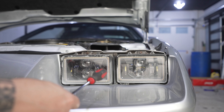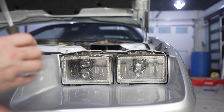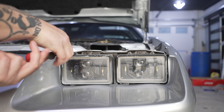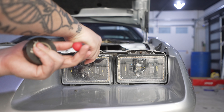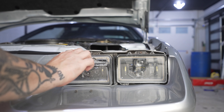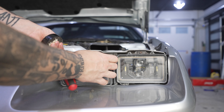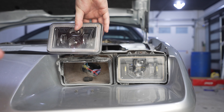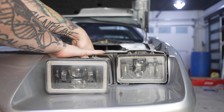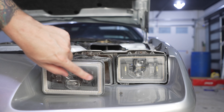So we're looking here at the headlight assembly. Mine's got a little bit of weight — I think a lot of them have little imperfections like this. You probably know about these two screws up here at the top of each of the headlight assemblies, right? You take these out in order to access — this is how you initially would get the light bulb out, just like this and it comes out. And there's my seven millimeter socket I've been looking for.